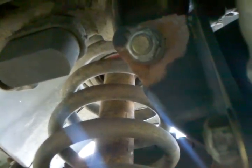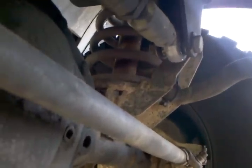See if I can give you a look at the back. That bolt you see back there — mine actually cracked there at one point in time and I had to weld it back. Reason being, I actually put the track bar on backwards. I had the heim joint on the axle side of it instead of the bracket on the frame.